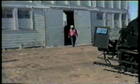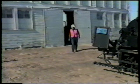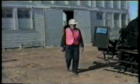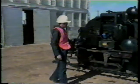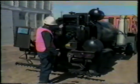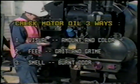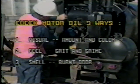This is the daily preventative maintenance check on a 600-gallon asphalt distributor. The first thing we want to do is to check the motor oil three ways. Visual for amount and color, feel for grit and grime, and smell for burnt odor.